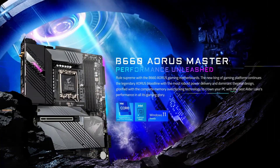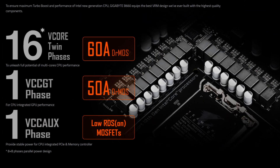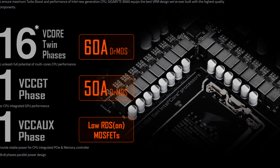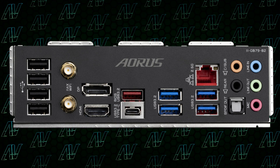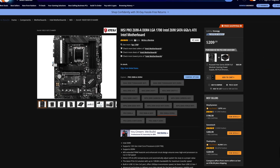So all in all, this board seems pretty good for the price, right? And while it is a pretty decent budget Z690 board, its main issue is that it has to share a price bracket with some of the most high-end B660 boards, including the amazing Aorus B660 Master, which I covered on the channel before. With that board you get so many extra features, including 16 phases running at 60 amps, not to mention 9 USB Type-A ports — USB for days. But that Aorus board doesn't have a graphics card bracket, so take that Aorus. And seeing how that board costs just $10 more, it's very hard to recommend this board when surrounded by so many other great options, both in B660 and some more expensive Z690 boards.